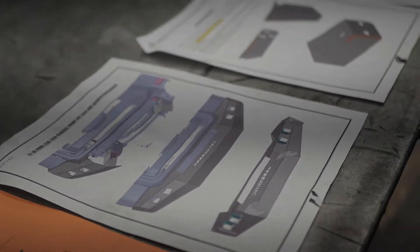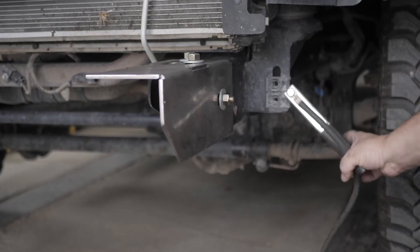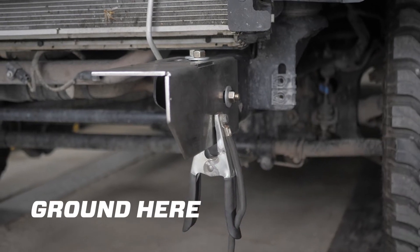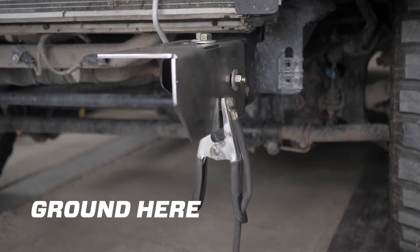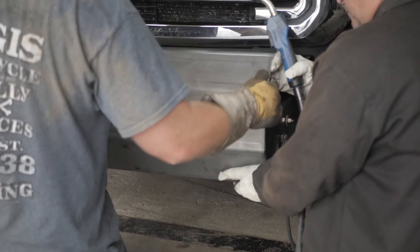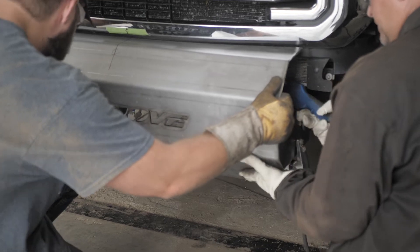Take notice of the provided curvatures of your vehicle compared to the bumper kit. Properly ground your welding machine to the project itself — we recommend grounding the welding machine to the frame mounts. Realign the center section if needed and tack weld the center section to the provided frame mounts on both sides.